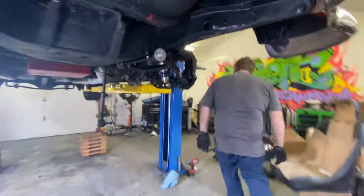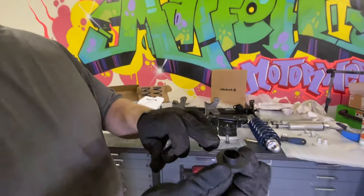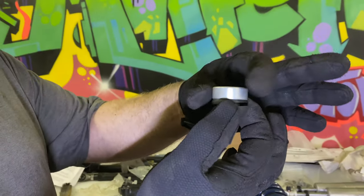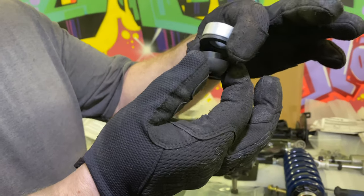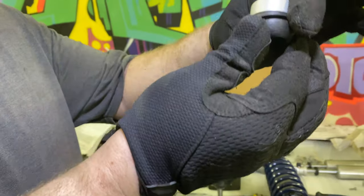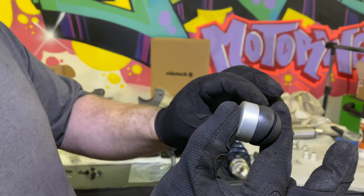If you follow me over this way, follow me, Dad. This bushing has to sit up inside there, and then it captures it this way, and they tighten inside of these cups to hold everything together. If that hole's not big enough, you're going to end up smashing that together, and it's hard to see up in there. You'll go to tighten it down, it's just going to smash everything, and it's not going to last real long that way. So, small little thing to be careful of.